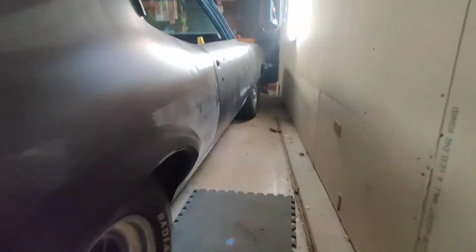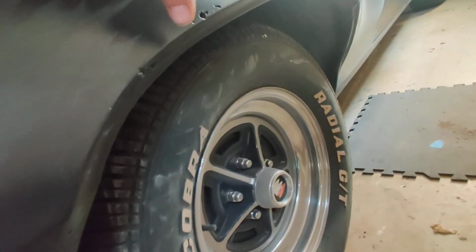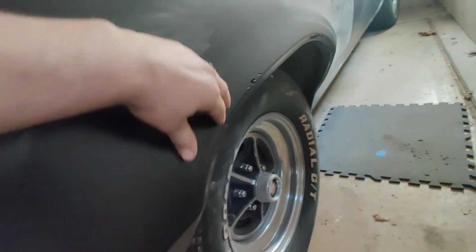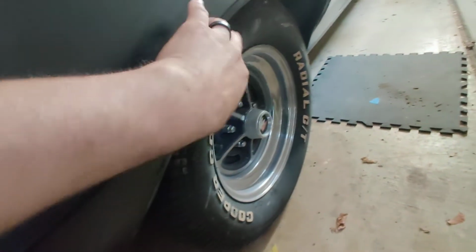This side has rust pitting in here, here, and I'm going to do this in small sections. Again, getting quarters or anything like that is just not what this job is going to call for. So we're going to make nice little patch panels, keep everything small, and then once everything is done, we're going to go on the inside with our wand, cavity wax the entire enclosure where this would normally gather moisture. And obviously when I cut it out, everything will get cleaned out inside.